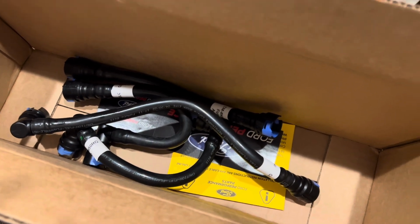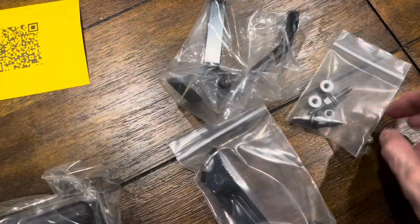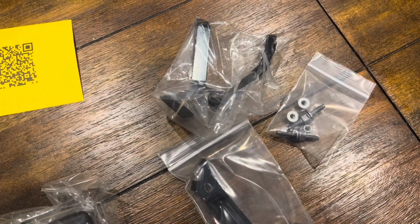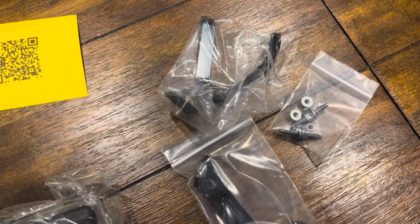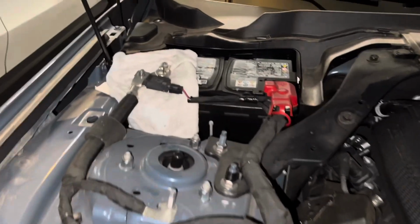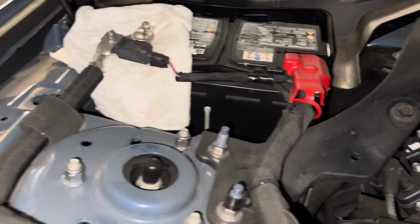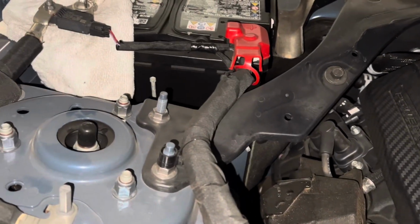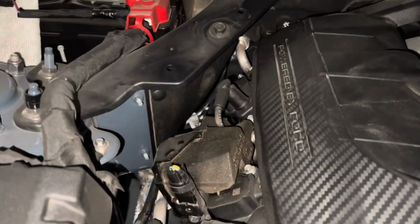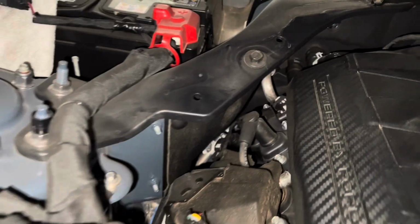I'm going to disconnect the battery just to be certain, because to put on these studs, you have to pop the grounds on the passenger side. So I'm gonna go ahead and pull the battery just to make sure I don't have any issues. Okay, now that we've got the battery negative unplugged, when you're taking the cover off here, there's three little hand unscrew fasteners. Make sure you don't fling one of them, because I've had to order some more. There's one of them lost somewhere down there.